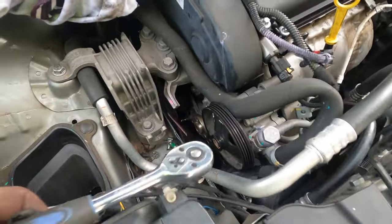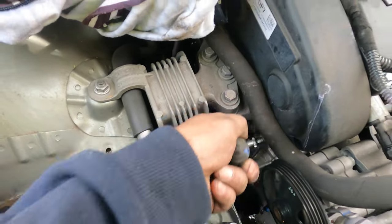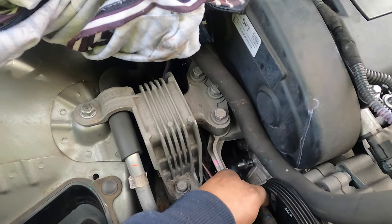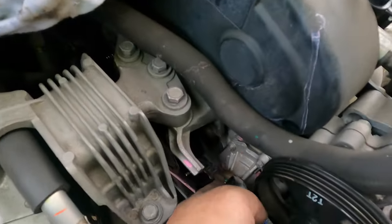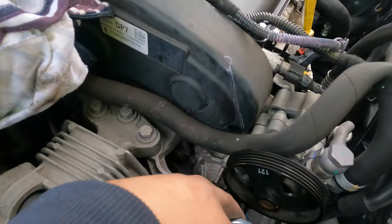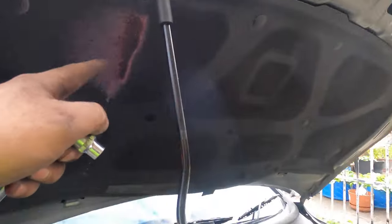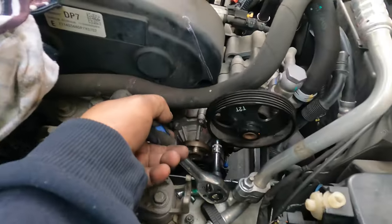For entry, undo the Torx number eight but this one is number ten. You've got to do the water pump because the water pump just leaked there on the pressure test. But when it's rolling, it's coming out from there - you can see the water spitting out on the main one, see the pink color coming everywhere and going up there. That means the water pump is leaking into the belt area.